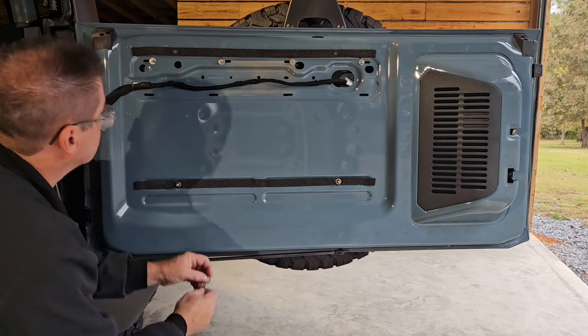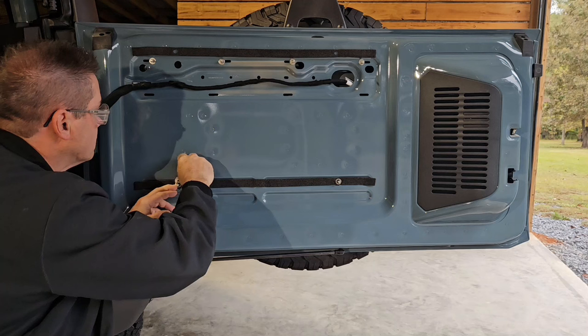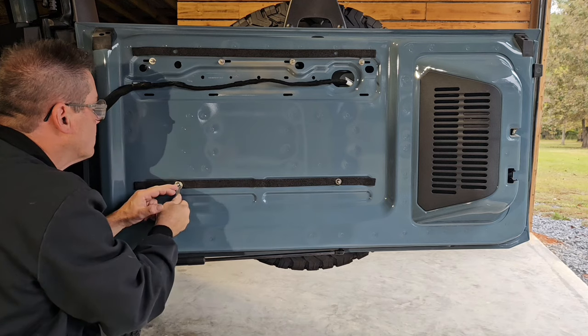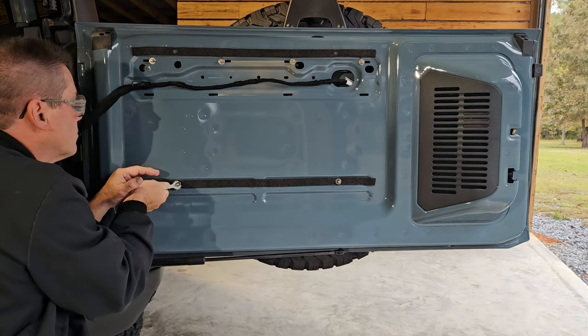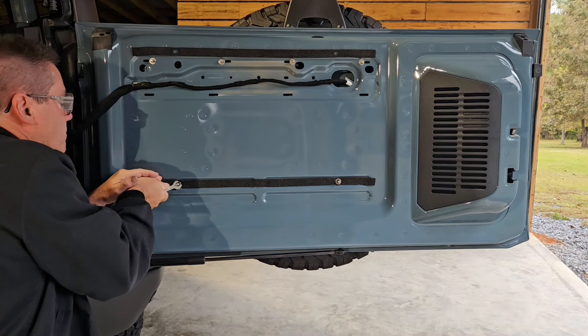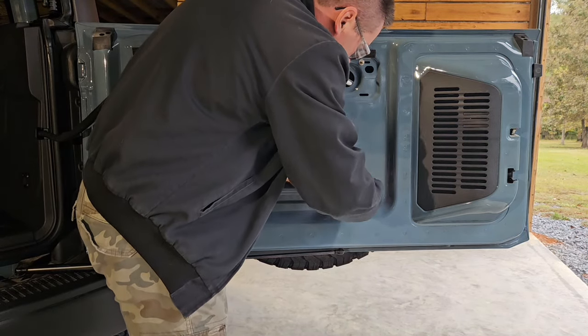Here I'm tightening the T-bolt lock nut down so that the T-bolt can't move. I'm using the included small wrenches to show that you don't have to have any other tools. You want to snug them up but not over torque them, and do this to all four at the top and two at the bottom. And then we'll place a washer over the stud before we put the table into place.